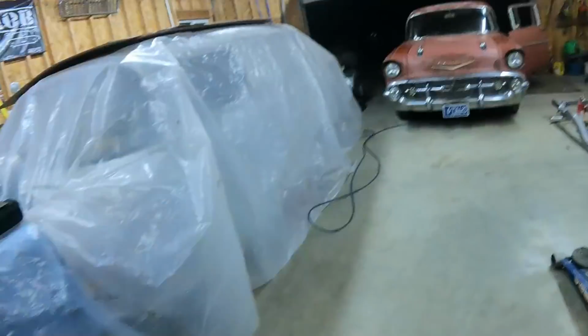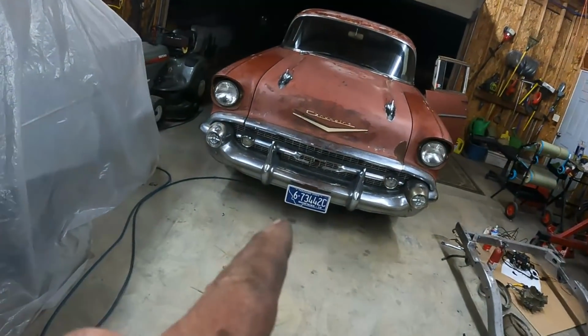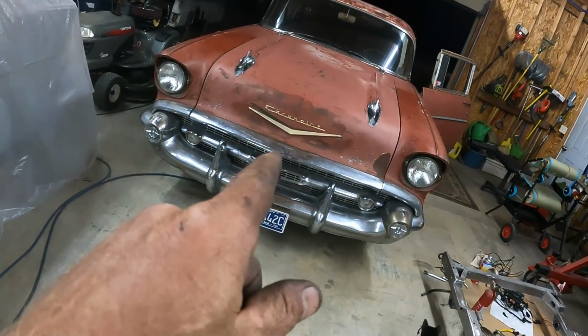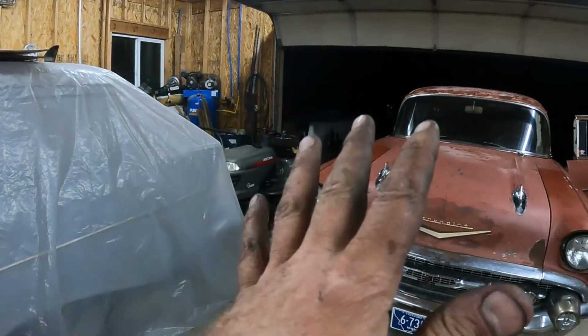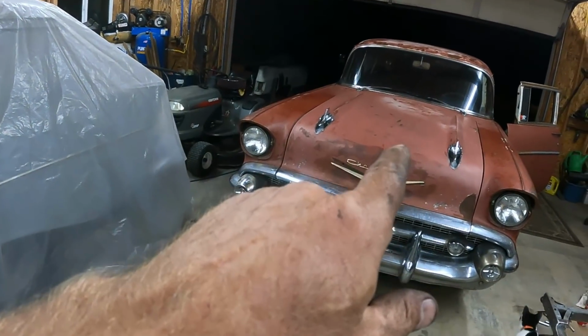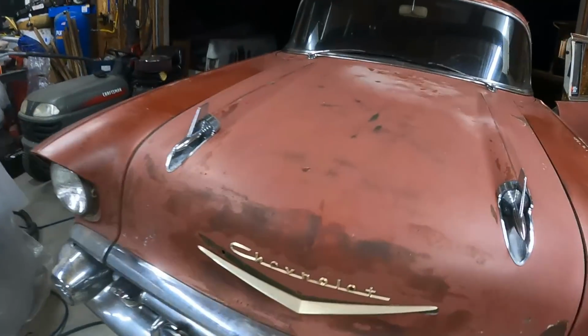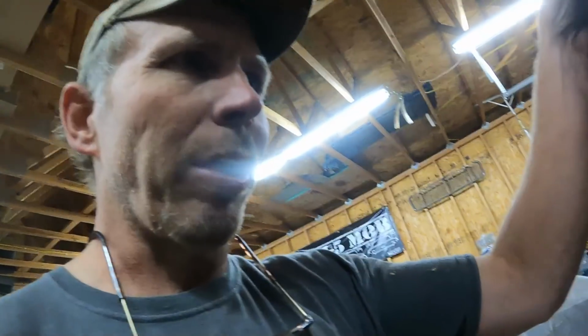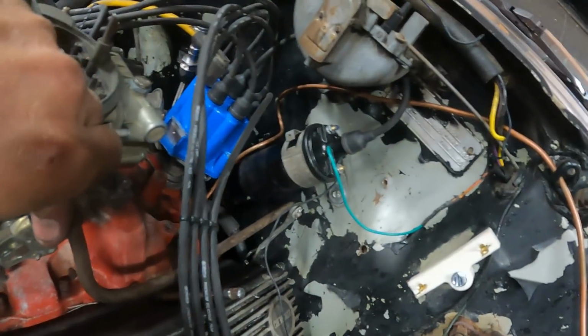I don't really believe in miracles, but I think it might be a miracle that this thing actually works now. Did the whole distributor swap, and I think it works. Got it close to timed. I did do one quick little burner on the block. I had a little scare again. This thing likes to scare me. The old throttle stuck to the floor again. The linkage, I didn't have the coil up out of the way, and the linkage hit the coil and stuck. So I had to lock up the brakes. She shut off after that though.